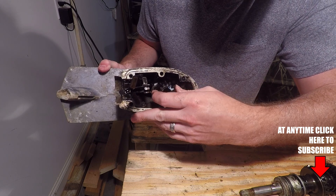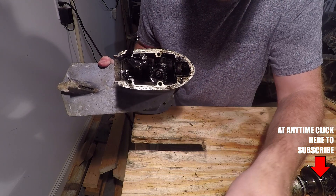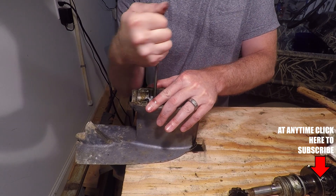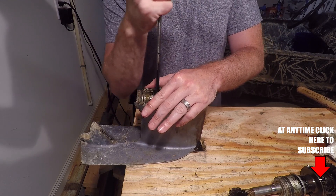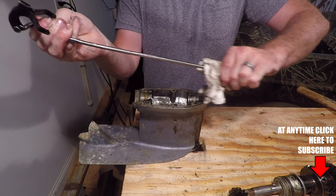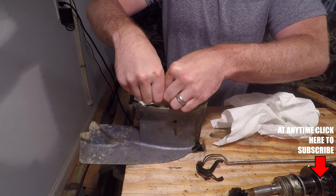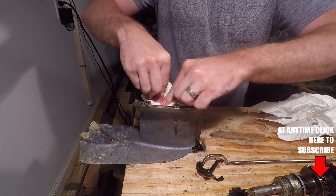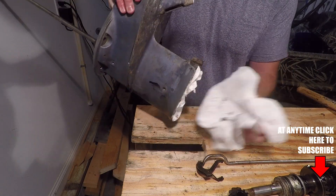The main drive cog is what connects to one end of the drive shaft. It should come out and there's a washer as well that comes out. At this point you should just be able to pull straight up on the shift rod linkage and it should come straight up. What I like to do here is stuff some shop towels or newspaper down in here — maybe cover it with some tape — so that whenever you flip the lower unit it's not going to get oil all over your floor.